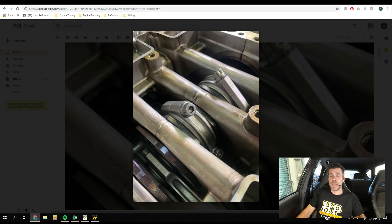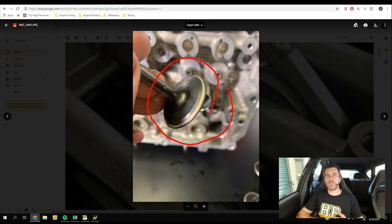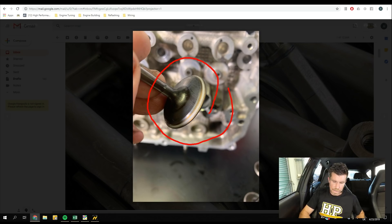We're running around about the 250 to 260 kilowatt mark on our Mainline dyno and that's on E85 at about 9 psi of boost. Another thing I wanted to talk about is the valve lapping — I've gone through and lightly lapped all of the valves. You might struggle to see it but that's the light grey line on the valve seat face. Lapping is a technique that used to be quite common, probably a couple of decades back, for getting valves seating nicely. The problem is that while lapping does a reasonably good job of getting valves to seat when the engine is cold at room temperature, it actually produces a concave surface on one side and a convex surface on the other. The issue is that as the valve heats up and expands, you end up with a really poor valve seat.